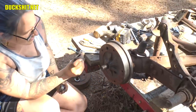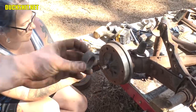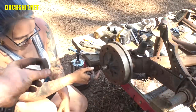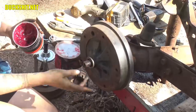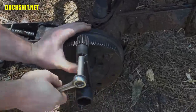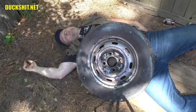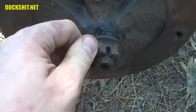Once the drum is on, this is where you need your axle spacer. I had a set from a rear disc brake kit I ordered some years ago — I didn't need the spacers back then, so they sat in my toolbox until today. Win! But if you need a set of spacers, you might be able to pull a set from the bearing cover from your donor parts car. I do recommend painting them as they are intended to sit in grease, or they will just rust something ugly. After the spacer, install your axle nut and torque it down to spec. The torque multiplier comes in handy here — it is highly recommended. Don't just think that bouncing on some cheater bar is enough to make it safe; the wheel will come off if you made a mistake here and possibly ruin your car or kill somebody. Don't be that guy. Lastly, install your cotter pin — if the hole doesn't line up, tighten the nut to the next available position.